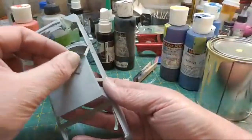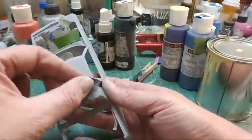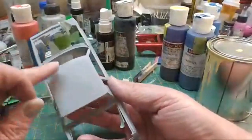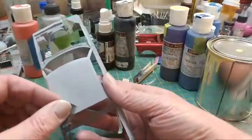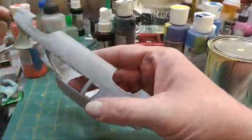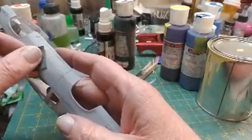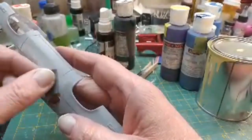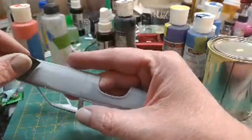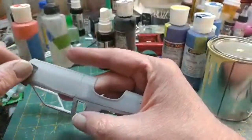You just lightly do that, and it knocks the edges out of it. You'll have a nice smooth, and this is a real dusty stuff with the high build primer. And if you feel it, it'll be nice and smooth. Now it's almost like glass there. And that's what you want. Hopefully that covers you guys on what I do on how my body prep works.